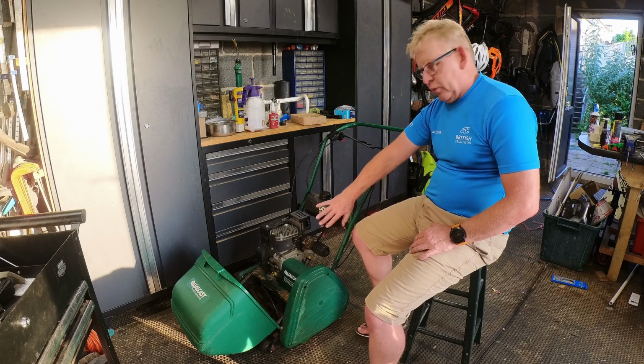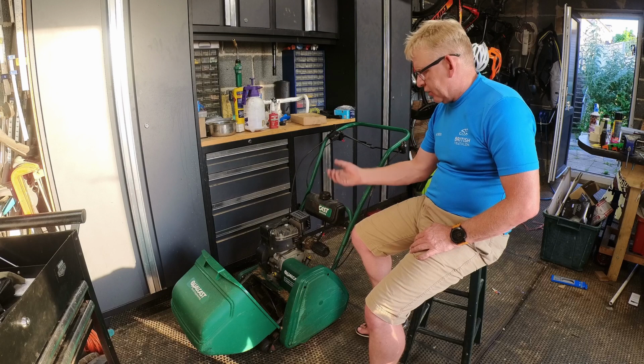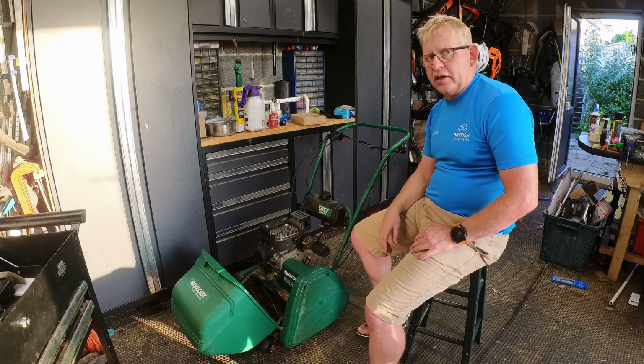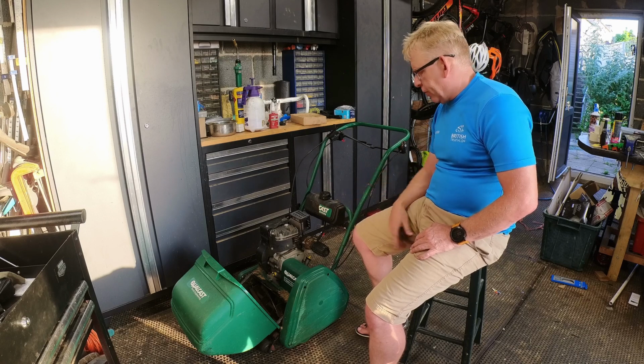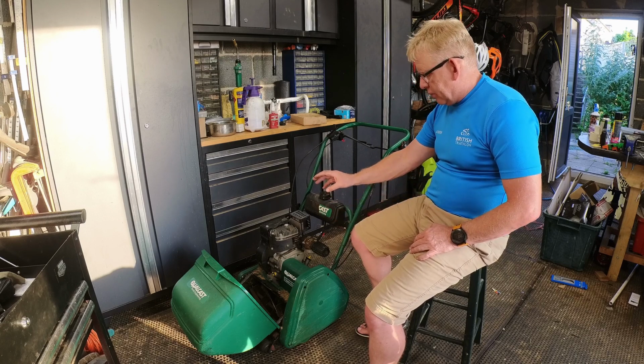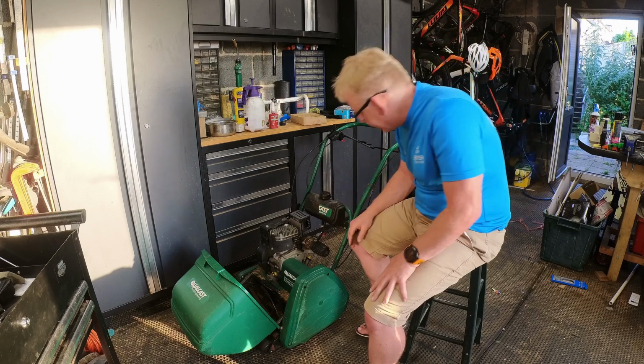I suspect it was me overchoking it, and I created such a vacuum that you got no other way of releasing the vacuum than to suck oil past the rings. It could be the rings are a bit sticky and that. I really don't want to take the heads off because I'd have to get a gasket set for it almost certainly. I don't think it's blowing round there.